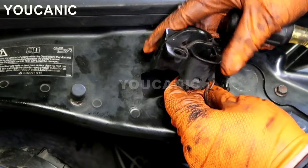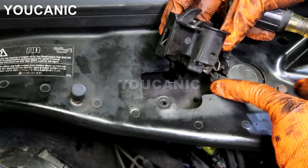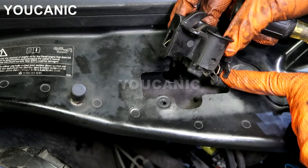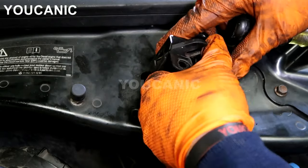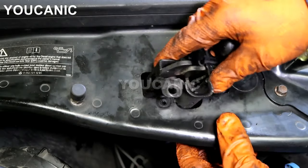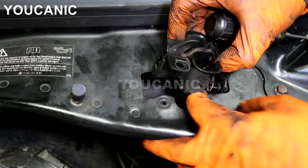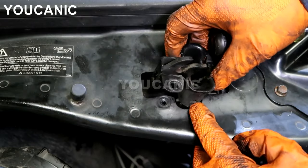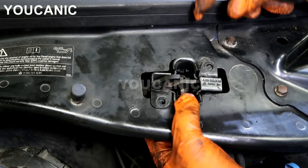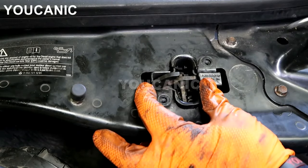When you do this, make sure the cable comes off this channel very easily — slide it back in. Otherwise when you try to open the hood, it won't open. Make sure the cable is seated properly and the electrical connector is put together and clicks.